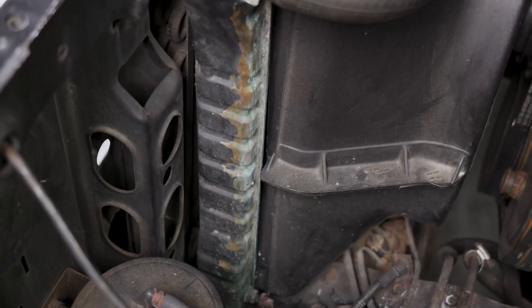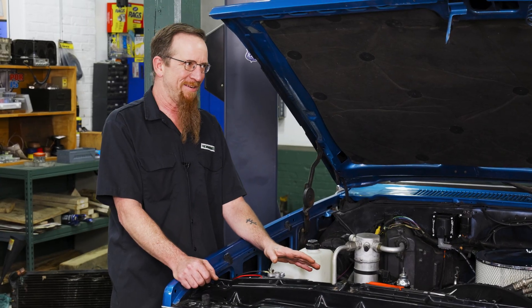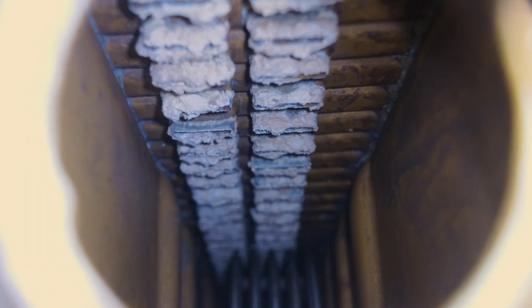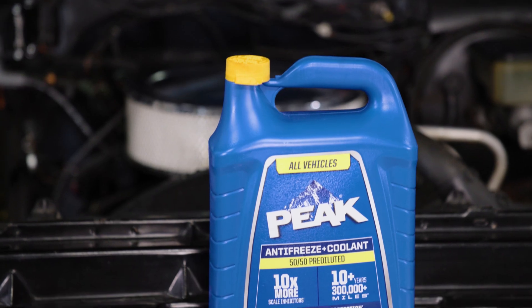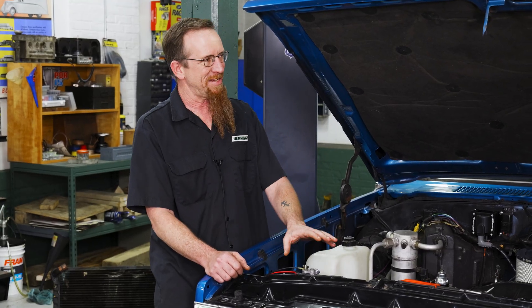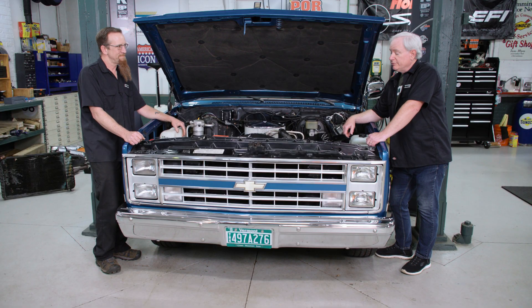One, this is a two-core radiator. As far as I understand it, AC trucks should have a three-core radiator, so right off the bat the radiator is too small. But not only that, we have a lot of calcification in the tubes, which tells me right off the bat that somebody was using tap water. You don't want to use tap water in your radiator system — it is not good for them. Distilled water, or even better, buying the pre-mixed 50-50. I know we don't like buying water, but it is treated water specifically to deal with the pressures and the temperature of a radiator system. So we're going to just swap this one out because it's obviously old and not even really the right one for the truck.